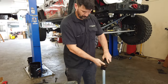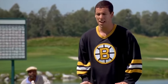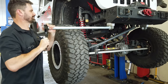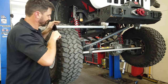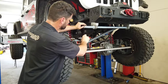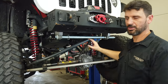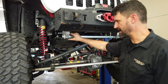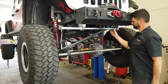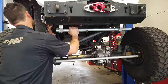I've put the passenger side arm on — super easy, just tapped it in with a dead blow. Both pieces are seated all the way flush. I put the clamping bolts in and tightened those up, plus the grease fitting on this end. Something a little different than previous model sway locks are these locking rings right here. Once we get it centered, we put them right up against the edges on both sides and clamp those in place, which keeps the sway bar from moving side to side. Pretty cool concept — makes the installation a little bit easier.